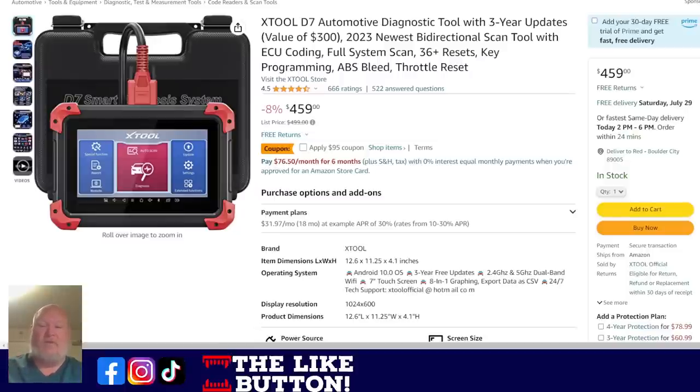If you're thinking this is expensive for an OBD2 reader — this isn't just an OBD2 reader. This is a bi-directional scan tool, which means you can send commands to the car. If you haven't seen my reviews on bi-directional tools, that's where you really change the game. It goes from just listening to the car to having a conversation with it. For example, I have an issue with the mirrors on our Ford — I can send commands directly to the ECU and tell it to move the mirrors. If the mirrors move when the buttons don't, I know it's the buttons, not the motor, and I can skip that step in diagnostics. That's where bi-directional really helps — it varies by car, but you can do stuff with the motor, transmission, radio, and more. If you're looking to step up your diagnostics game at the prosumer level, the X-Tool D7 — I don't know if you'll find anything cheaper than that.